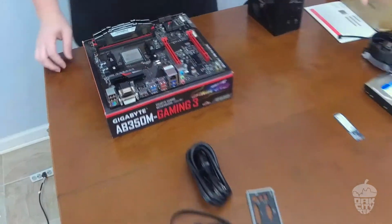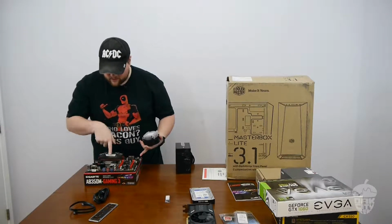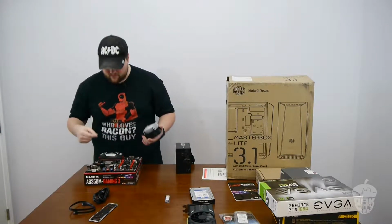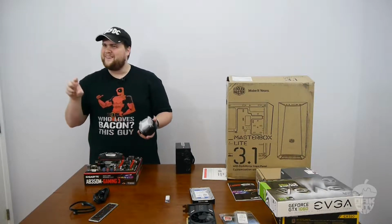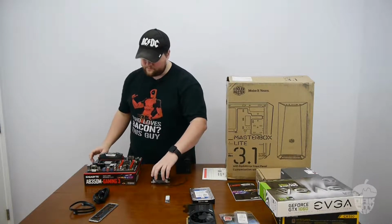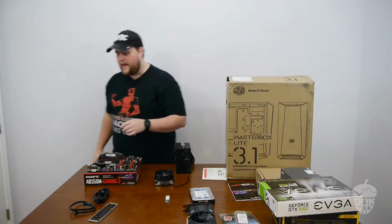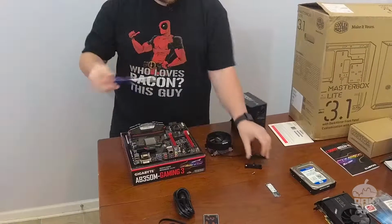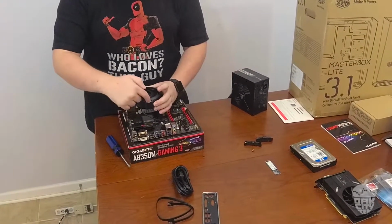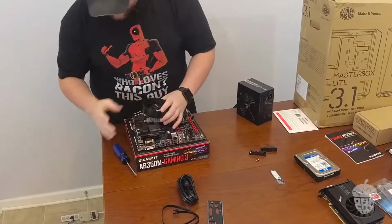Does it matter which orientation anymore? Nope. No. Well, yeah, it does. There is a key that's like, I don't know, maybe 40% of the way. Yeah, there is a key offset direction from the center. You meant, when you said no, you meant it doesn't matter which slot you put them in, right? Right. I remember before they had to be the same size. Yeah, RAM, they've gotten a lot better about making RAM. It doesn't have to be, but it's ideal. And that's disappointing. I'd want the AMD icon to be up top here, but it's going to have to be pointing towards the IO shield.